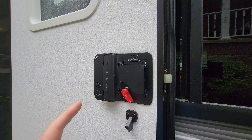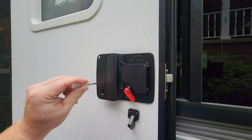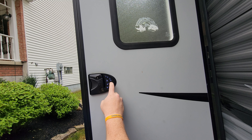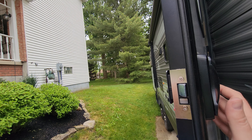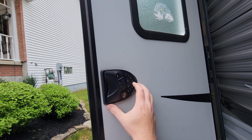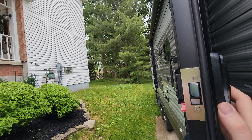To do the keypad part, hold down the code reset button until it prompts you. You have 30 seconds to put a new code in — enter the new code, then press lock. New code accepted. So we're going to go ahead and put in our code, hit the lock button, and the lock has been activated. Put in the code again, hit the unlock button, and it's retracted. That is super easy.